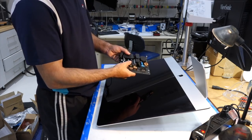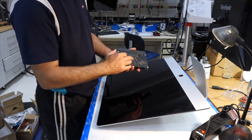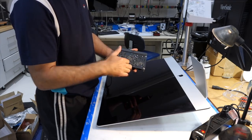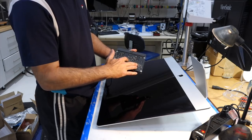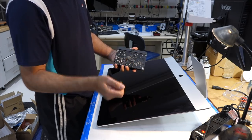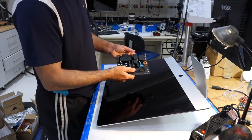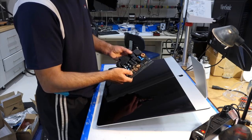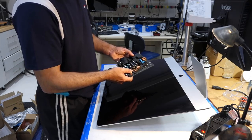This is the only place in the Mac where there is a chip — actually two chips — that are able to turn the thing off. They will latch the error, and you can't power it back on unless you unpower the chips. So I think the diagnosis is fairly confidently the power supply.